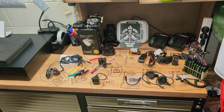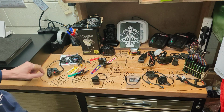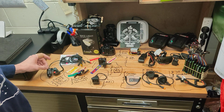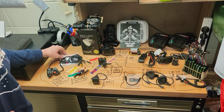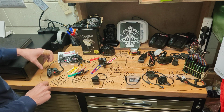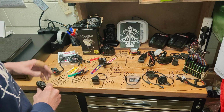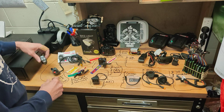So with those things in mind, the functional design progresses us from a switch to one that actually has the slider in it. The horn is a red push button, nice and easy to access. And the light switch is a toggle left and right. Now the left and right toggle on this is actually wide, so there's actually two outputs from the headlight. So you can have a low beam and high beam. So we introduce on the wiring harness, as part of the TurboTap switch, an output for low beam. So it's a high-low light and horn switch with turn slider, effectively.